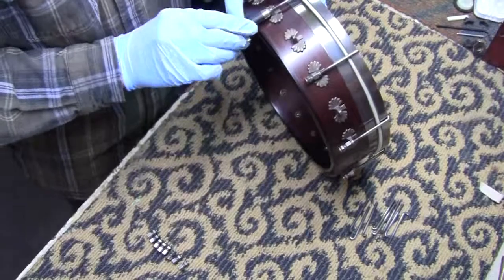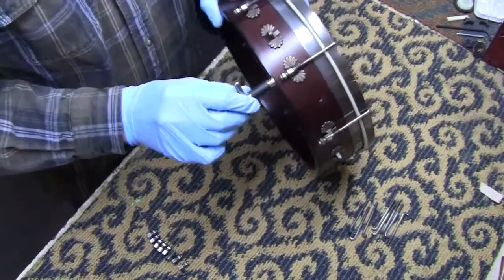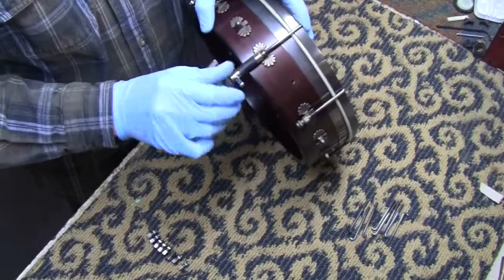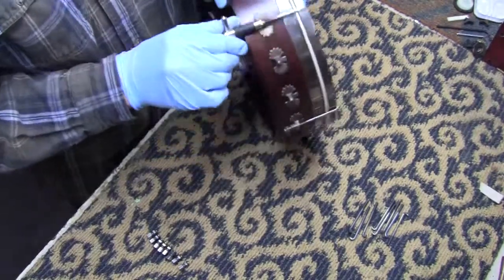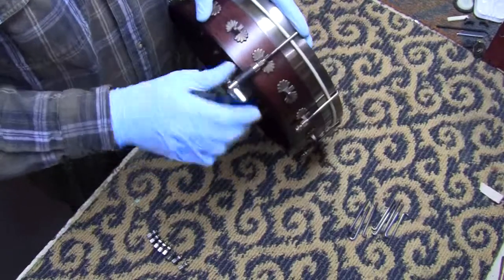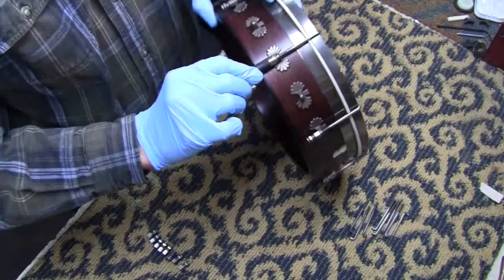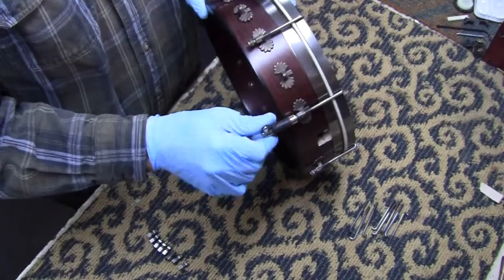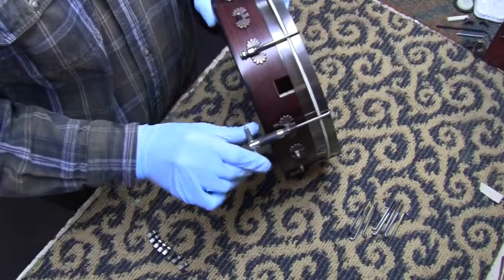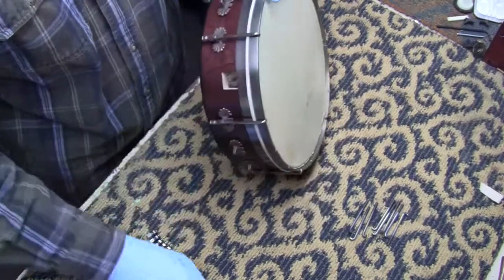Okay, now the ones we didn't, we're just going to kind of cinch, and you can feel how tight the nuts are. So you want to tighten them until they're about the same tension that the first 4 were. And you can feel it. Kind of like a torque wrench in a tire store, where they stop once they get a certain tension. You can just feel that.